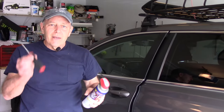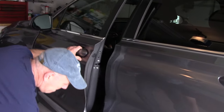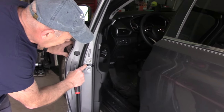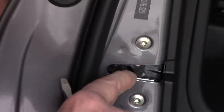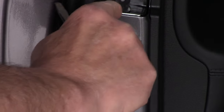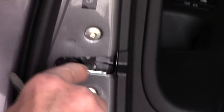What you want to do is get yourself a can of spray lubricant and a screwdriver. Just open up the door. The problem is that this latch right here gets flipped over, and a lot of times as cars get older, or it's cold outside, locks today are made of plastic, so the plastic tends to expand or contract and it doesn't flip up all the way.